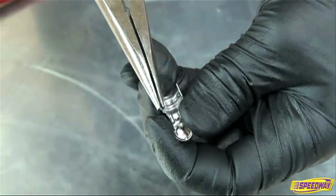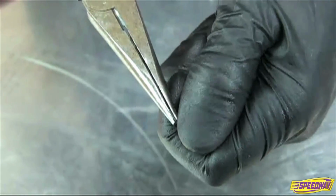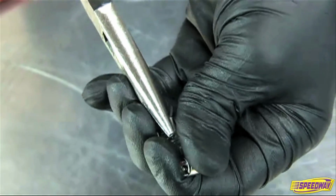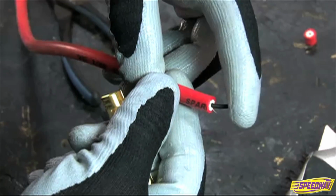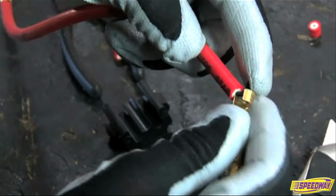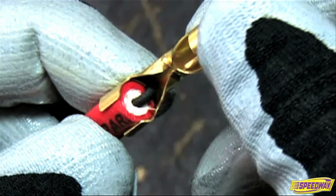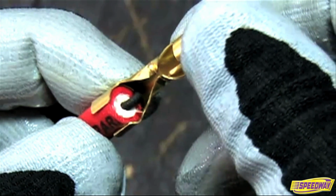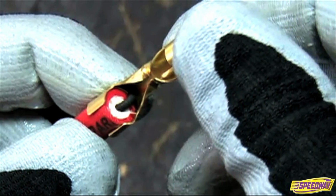For the crimper tool to work properly and achieve the strongest crimp possible, bend the crimp tabs on the terminal 90 degrees at the end of the tabs. For standard terminals, such as when using an old-style socket terminal, fold the spiral core back against the wire insulation and slide the terminal over the wire. Position the plug wire until the wire insulation protrudes past the crimp tabs about the width of a nickel.